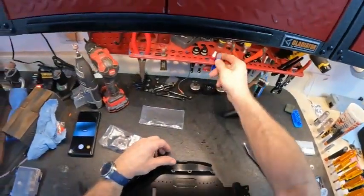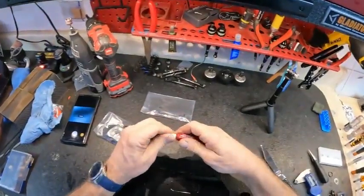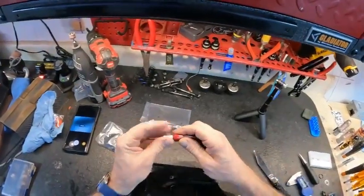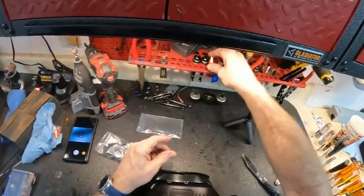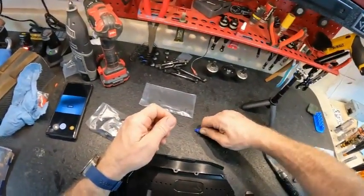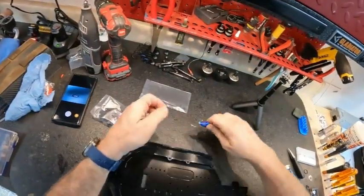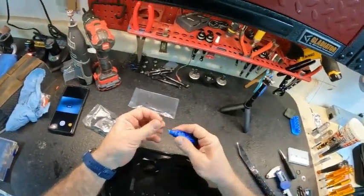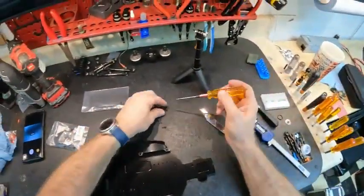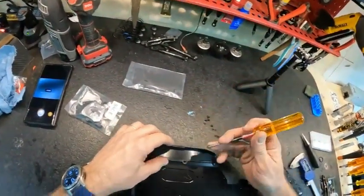It comes with the pad and the battery stay - I may save that for later. I'll get some blue Loctite and shake it up. I'll put a little bit on the table. This is the gel Loctite - I kind of like it. It doesn't take much for these tiny little screws. This is a pretty simple process - you're just screwing the mud guards in.